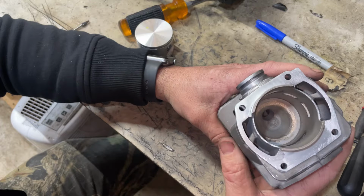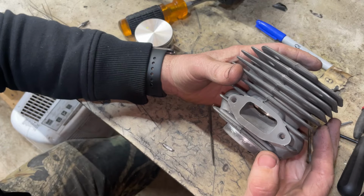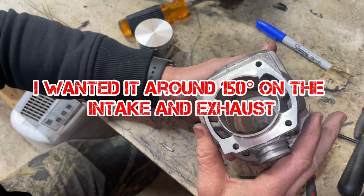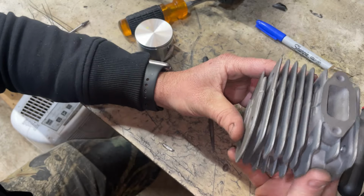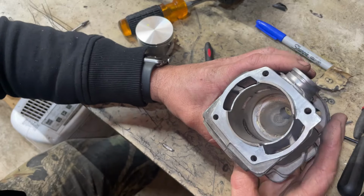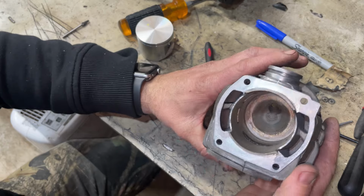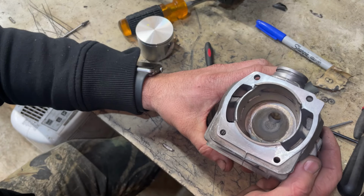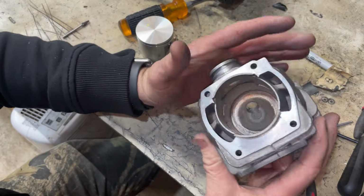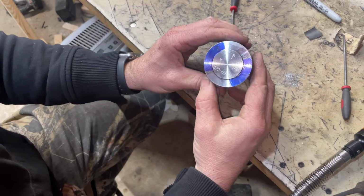I think I left off somewhere around a 99 exhaust roof, which is a little high. And I'm not going to be able to achieve that unless I were to cut the squish band. And it's just near impossible without a machine. I shouldn't say that, because we cut this base, right? We did that without a machine. Now, could I get a perfect circular sanding pad in there, maybe? That could be possible, but I already am going to have so much time wrapped in something that I don't know if it's going to work or not. So let's just hope for the best, guys. Uh-oh.